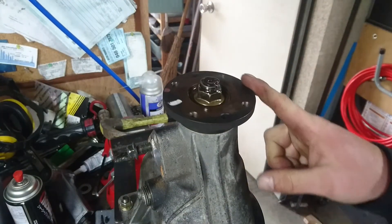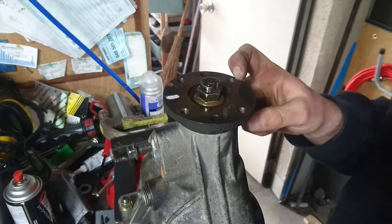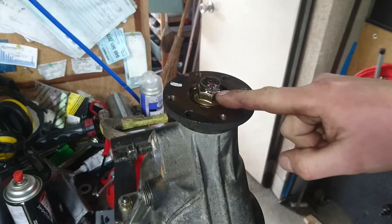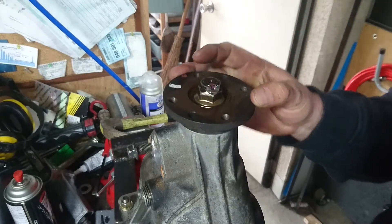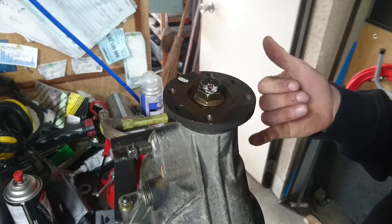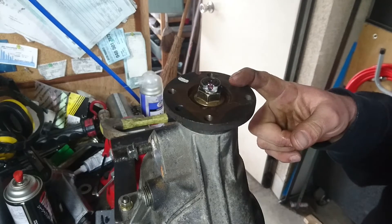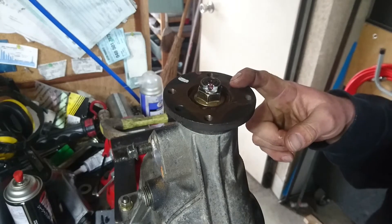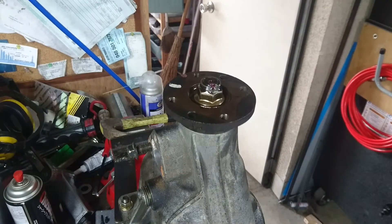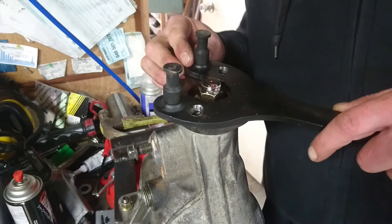Okay, now I'm ready to remove this and I can put it on the DA32W gear set. But I had to grind this out because it was pressed in too much and I couldn't get it to let go, but I ground it off nice and clean so hopefully that will spin out without ruining the pinion. I made this - does this fit this diff? It does - excellent. So I need some... M8 bolts - it's an M8 bolt. Oh, these work nice.